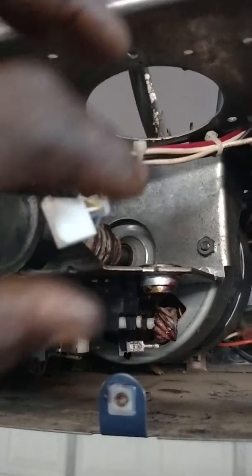In order to change that gear, you will have to remove your motor. Take this plate off here, and there's a set screw on the back side of this sensor pickup. It reads from those little sensors right there. There's a set screw right on top there. You have to pull all that off, pull the motor out — there's some screws back up in there.